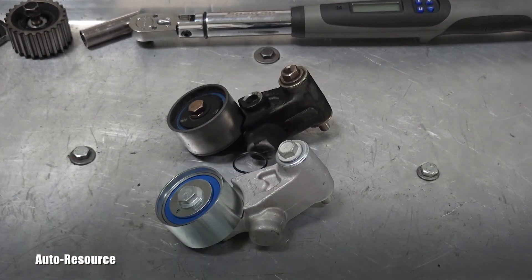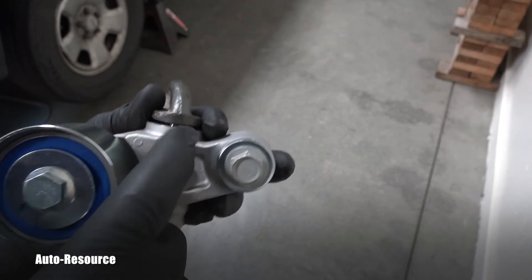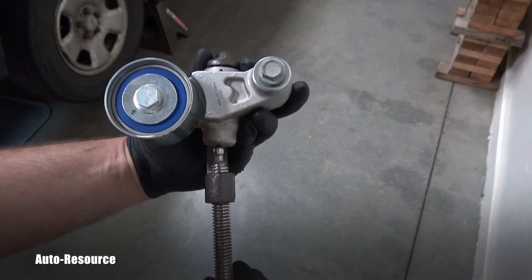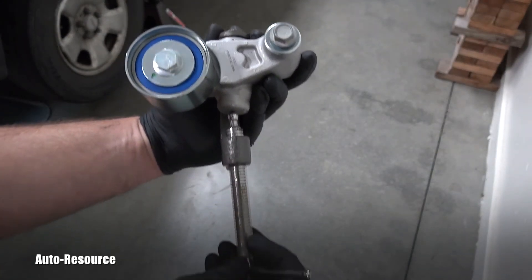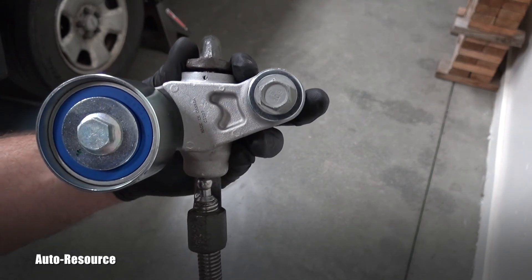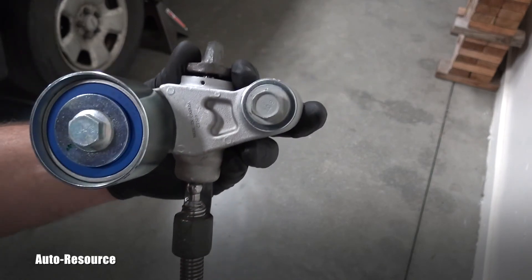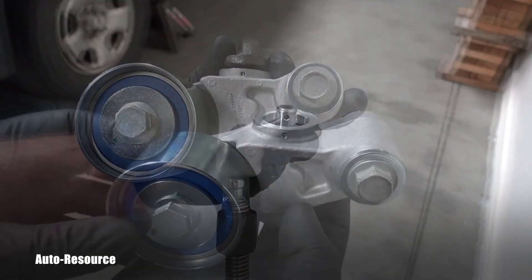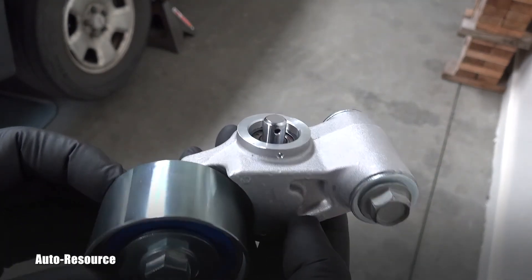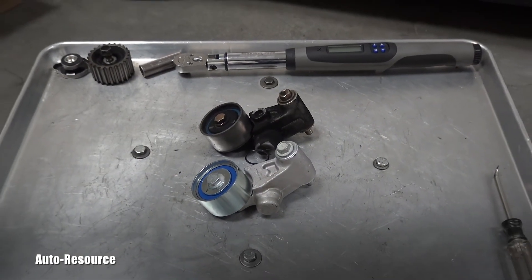Here you can see it — I clamped it, applied a tiny bit of pressure, removed that pin, and now I'm very, very slowly — it needs to be over one minute — letting that pin come out of the tensioner, really taking my time. Then I will push it back, line up the pin, and it will be ready to be installed. Just to give you an idea of how much that pin goes out: you can see it's about four to five millimeters, and that whole movement has to take more than one minute.